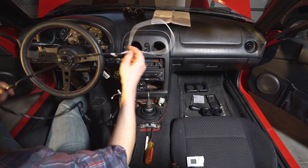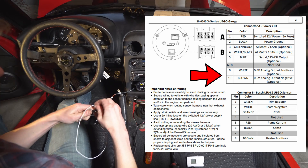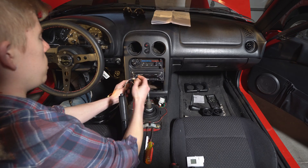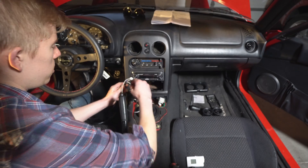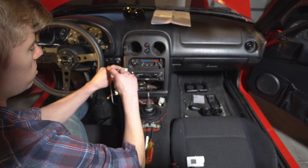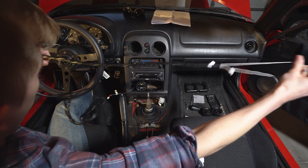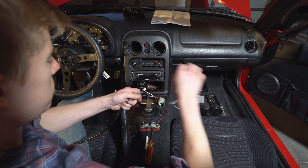The analog 5-volt signal comes across the white and the brown wires. I'm going to run the power to the buzzer 12-volt switched connection. I need the analog signal to break out and send it along the transmission tunnel over to the Megasquirt. I'm going to pull those analog wires out here so I can break out right by the radio — that's the white, pins 9 and 10. There's also a white and black wire, but that is not what we want.